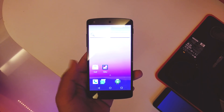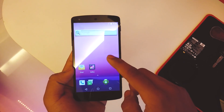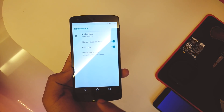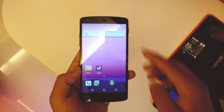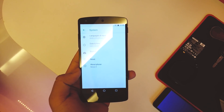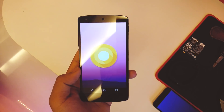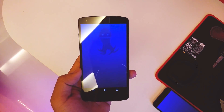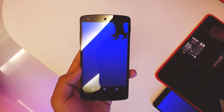Since I didn't flash GApps, there was no setup screen. As you can see, this is the ROM itself — we have the Pixel Launcher with notification dots, home screen rotation, and other features. Going into Settings, then System > About Phone, you can see the version is Android 8.0. Tapping on it reveals the octopus Easter egg, confirming this is the 8.0 ROM for Nexus 5.